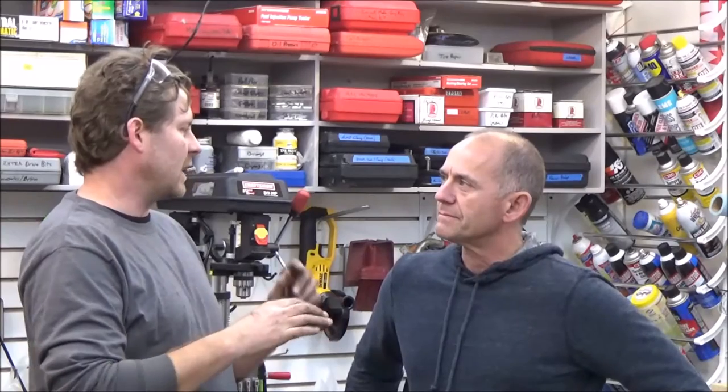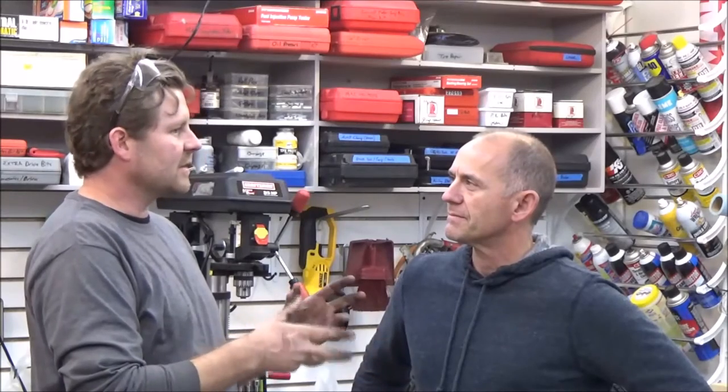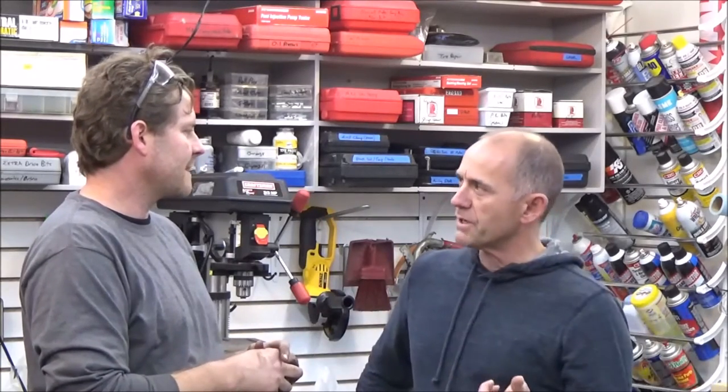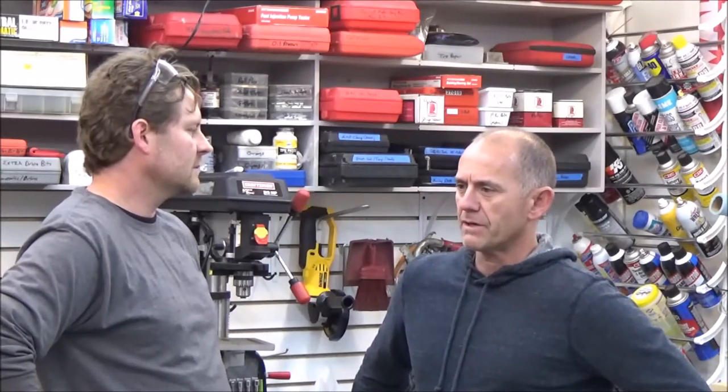So how do you feel about the lessons? I really highlighted some stuff on you, because you wanted to tackle this yourself. There are some safety issues, some things you really need to think about — keeping the clips in while you're removing the brake pad, scraping it down with a wire brush just to get all the rust out, spraying it down with brake cleaner just to clean it up. The majority of those tips were recommended.